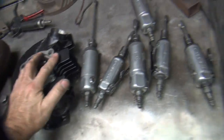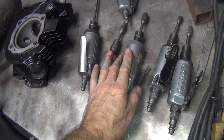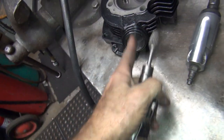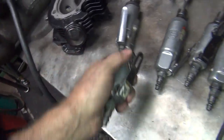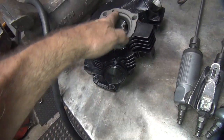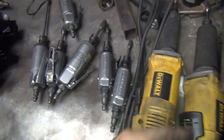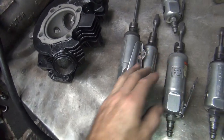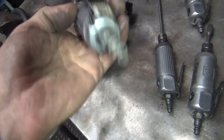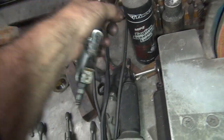I forgot to address some comments about what I use for doing my work here on my cutters. We use die grinders — quarter inch die grinders. I like front exhaust exit because it blows the chips away from me and it keeps the port clean. I use the electric grinder here, but it fills everything up with chips and for some reason it always kicks back on my face — always throws stuff in my eyes. The air ones blow stuff forward so I like the front exhaust. Plus it's a lot quieter, and you get oil coming out of here when you oil them because you're supposed to use air oil on them.